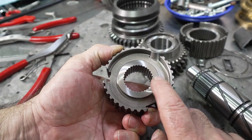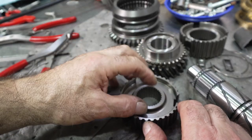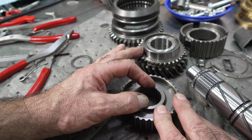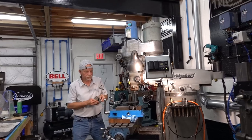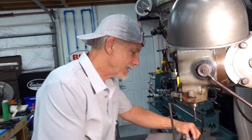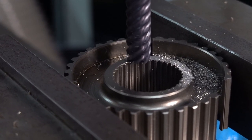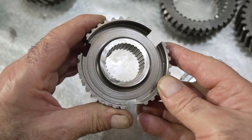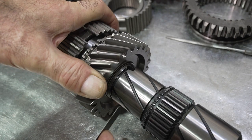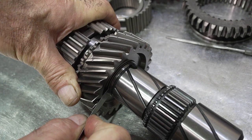I want to take material off the snap ring surface, not the thrust surface the gear goes against. We're going to take it over to Danny next door and put it on his Bridgeport, measure with a depth mike, and take ten thousandths off that surface. I got a carbide end mill to cut through the hardened metal. After machining, the 3-4 hub is back on with the 87 thousandths thick snap ring — took ten thousandths off the hub and I now have a twelve thousandths feeler gauge fitting in there nice and tight. Perfect.